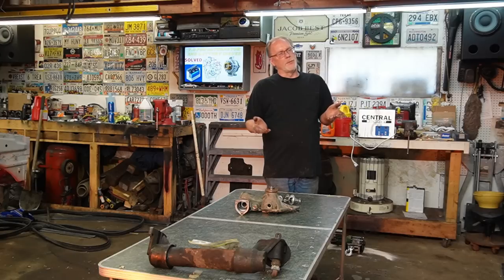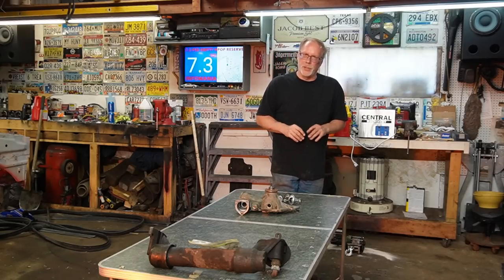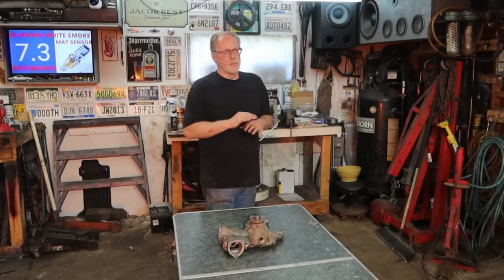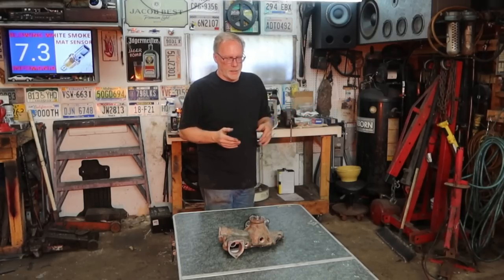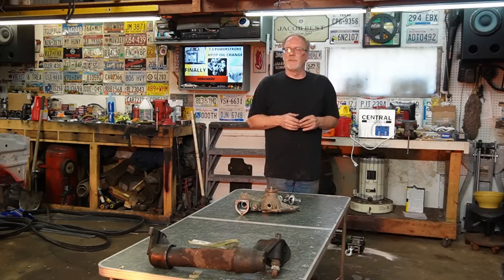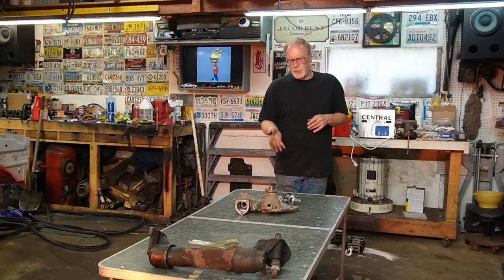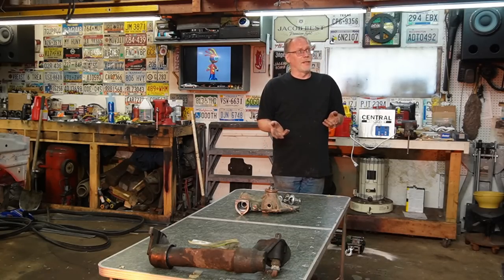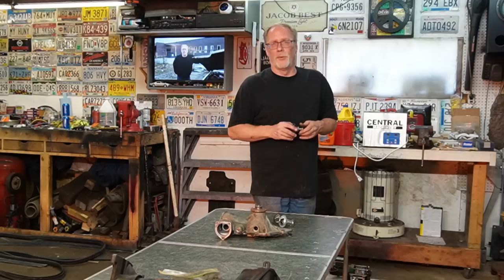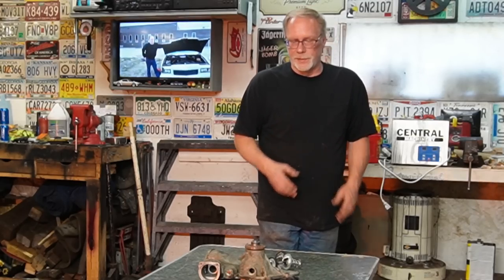If somebody pinned me to the wall and said, okay, you have to make a choice, I would say running a 200 degree would be just absolutely fine. It's not too high, it's not too low. That engine is going to run just fine. There's no other purpose to spend more. I was almost horrified when I ordered the thing. They wanted like 30, 40 bucks for the 205 thermostat, and then they hosed you another like 20 bucks for delivery. I mean, holy Jesus.